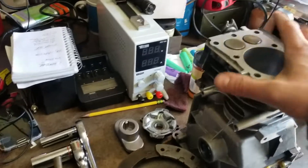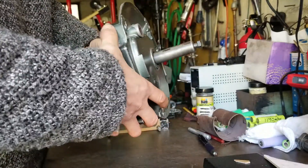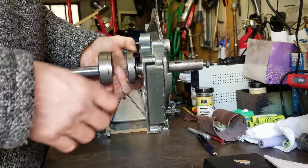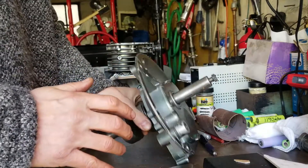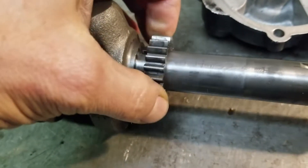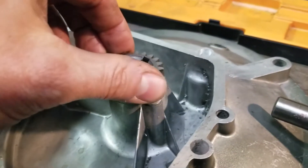I took off the flywheel and got it out of the crankcase just to see what's binding. You can see now it's stuck — the diameter changes from this size to something slightly bigger, and that's what grabs the bearing and holds onto it. So I've got to get the support and take down a little of that surface so I have more room. That would be perfect if it was on a lathe — I've got a friend who has a lathe. The gear meant for the timing gear acts like a spacer on top that slides.